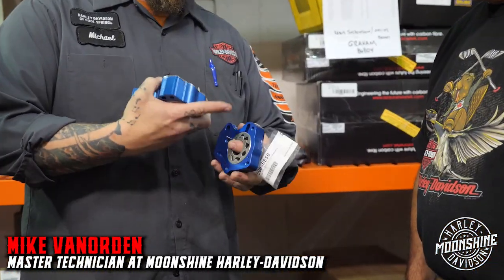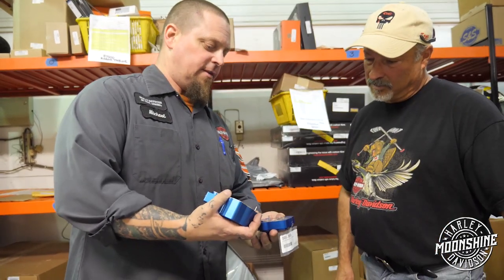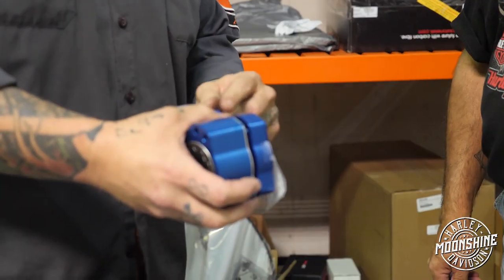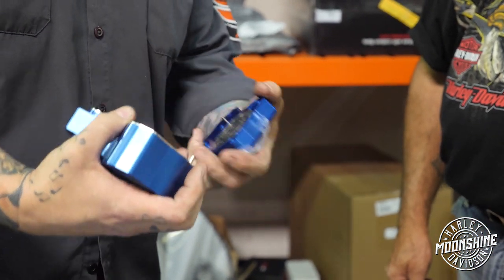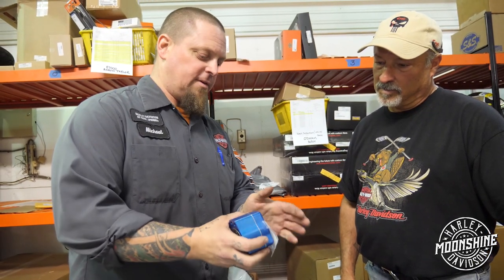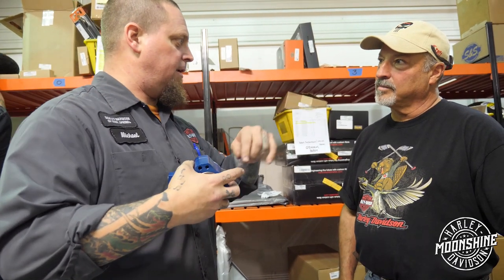The best thing about the S&S oil pump — all oil pumps have two pickups, one for the crankcase and one for the cam compartment. But what S&S does, they actually split the gears, so there's a dedicated chamber for the crankcase, and then the cam compartment pickup goes through this screen, through this passage, into the next gear over. So you don't run the risk of cavitating the gear. Because if you have oil in one compartment and nothing in the other, it'll pull air through and mix the air in with the gears, which slows the ability to move the oil through the system. That's why we like the S&S pumps so much.